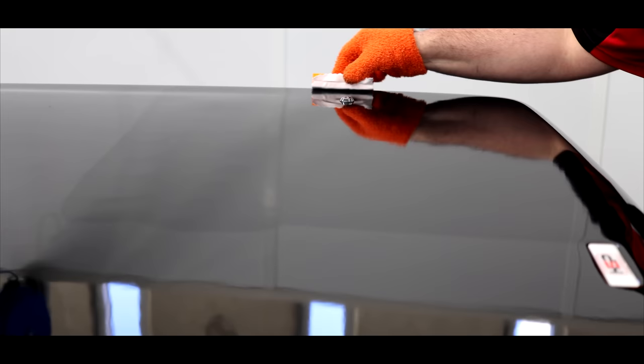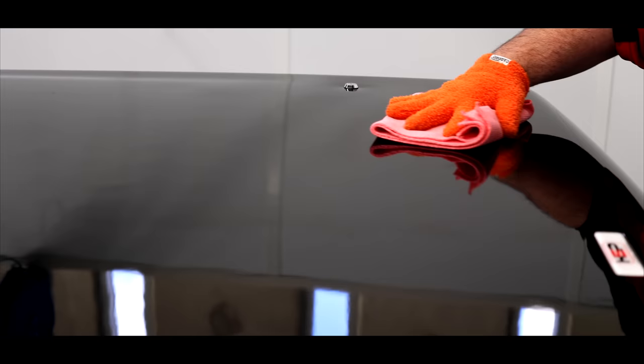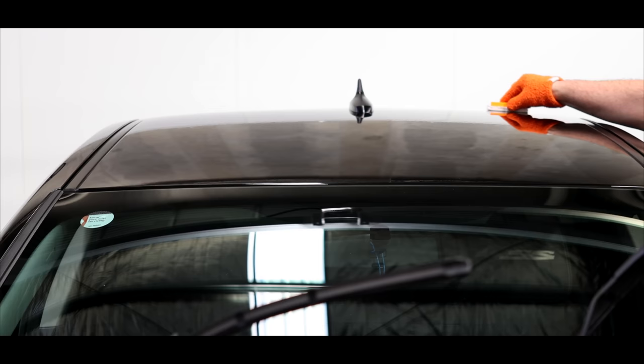Beyond that, its hydrophobic performance is truly impressive based on some prior applications and testing I've done. And I've seen one layer of this new version last twice as long as two layers of the previous version, so I've got a lot of confidence that it will be a fantastic long-term coating. So after some testing to discover its optimal flash and wipe-off times on that particular day, I proceeded to ceramic coat all the paint, plastic, and rubber trims.